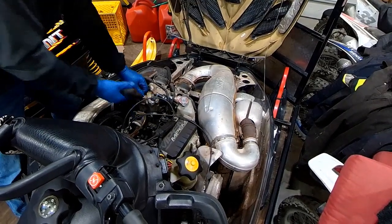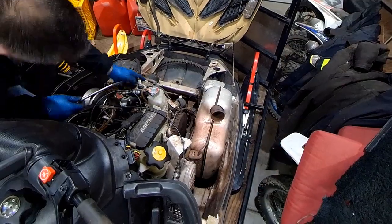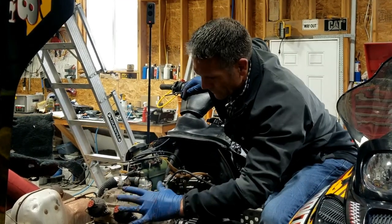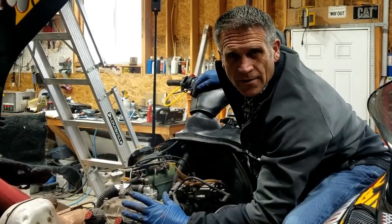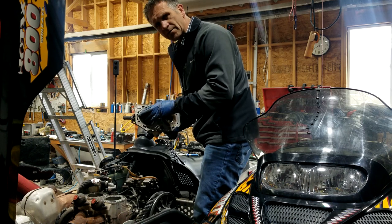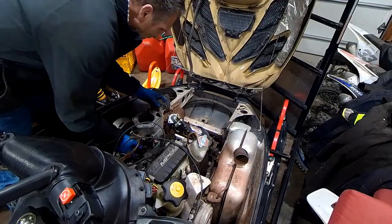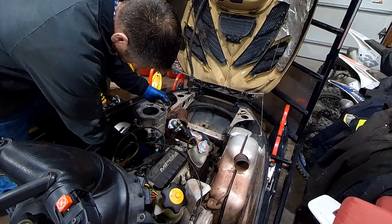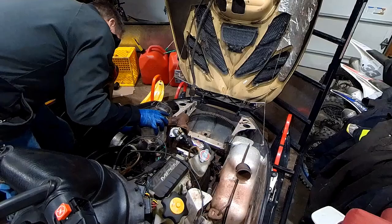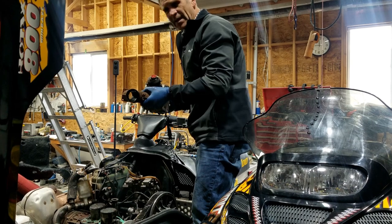Here's what we're going to do: pull the air box, pull the carburetors, pull the exhaust off the front, then drain the coolant out of the engine. From there I should be able to lift the cylinder head off and pull the cylinders off. One of the exhaust manifold bolts is being a little stubborn but the other seven came, so I'll focus on that one when it's more accessible on the bench. We can pull the cylinders just the way it is. The head seems to be in good shape — no heat marks, no apparent burn spots, though it does show signs of incomplete combustion. The cylinders are separate on this machine, which is actually convenient. We'll reuse those parts as-is and put new rings on the pistons, looking for a higher compression ratio.